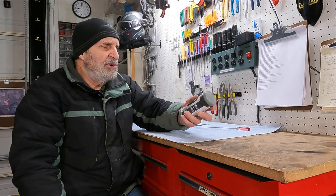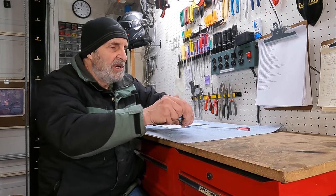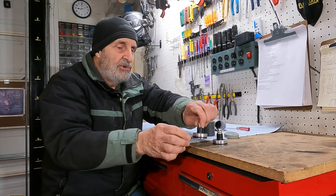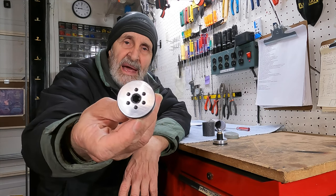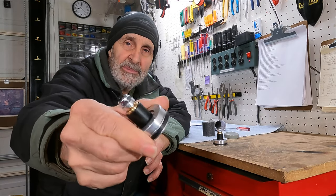And so I just wanted to show you what these Intiminators look like on the inside here. There's one, and then there's two. And this is kind of what they look like right there. They got oil orifices in the back like that, and they got a secondary circuit that opens up when you hit something real hard.